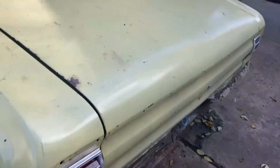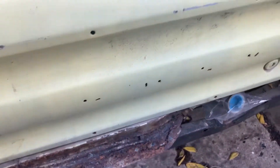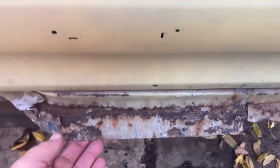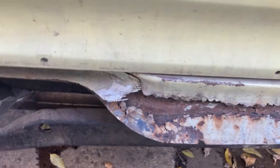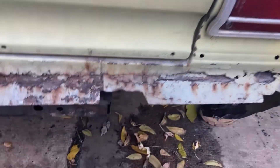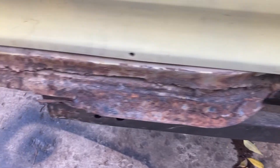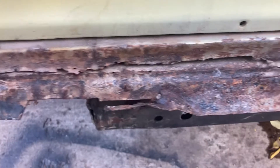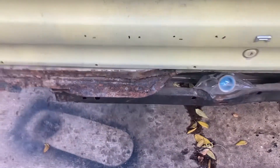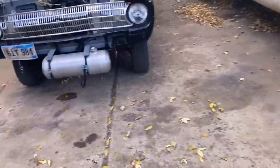Got to get the taillights, the doors. We got to do these back pieces right here — somebody did fiberglass it looks like. I'll cut that out, make a pattern, and cut it out — probably with a grinder so I can cut it straight without putting too much pressure on everything else around it. I'll go ahead and weld those two pieces back together, seam it, seal it with all new steel. I still got the pattern. Keep on clicking — stick with South Dakota pride with the 605.